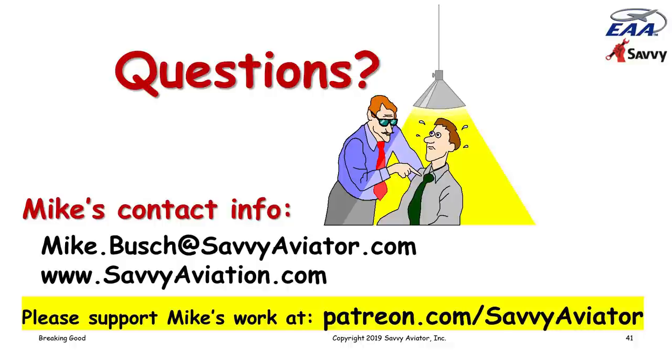Phillips Type M was actually designed specifically for break-in. Regarding reports of problems with the use of CamGuard in Continental engines with certain types of AeroShell oil — I have not heard anything of the sort. I've got somewhere on the order of 800 aircraft whose maintenance is managed by my company, the majority of those aircraft are Continental-powered and do use CamGuard, and we have never run into any problem. I've used CamGuard in my own Continental-powered airplane for well over 10 years.